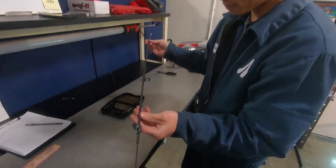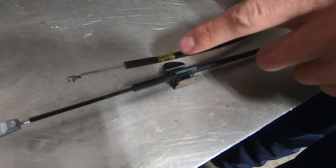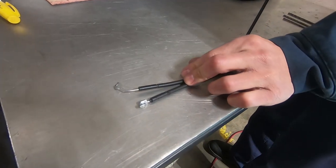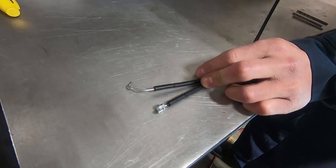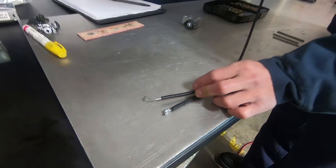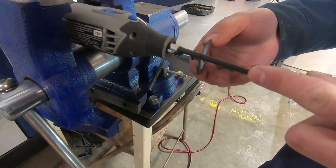I've got the cable modified. This is the blend door cable — I measured 27 millimeters where this thing attaches, from here to here. The plastic sheathing you have to cut off, and then I used a pipe cutter to scribe two lines for where the clip goes on and secures it to the climate control unit. It's not the most elegant method, but I just used a Dremel little by little to cut out the slot.